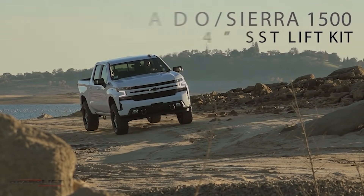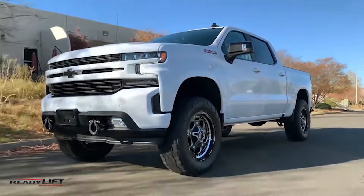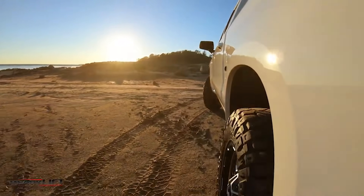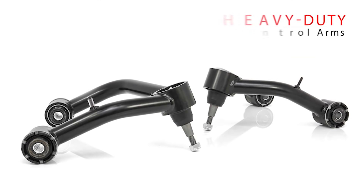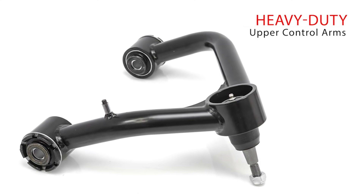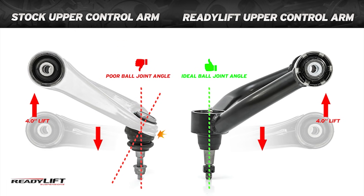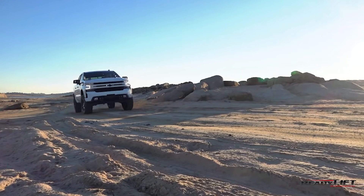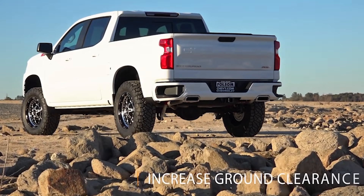Next up on our list, we have the Ready Lift four-inch SST lift kit. Although Ready Lift has started to get into the bigger kits, they've been doing their SST kit lineup for quite some time. With the success of the kit for the 14 to 18 GM 1500 trucks, they decided to continue the trend and bring it back for the 2019 trucks. Coming in at only $900, you get a really nice quality kit that includes a CNC billet aluminum spacer and new tubular steel upper control arms with adjusted ball joints. One of the best features is that it is a no-cut, no-weld, strictly bolt-on kit, making it easy to install yourself. With four inches of lift in the front and a three-inch block in the rear, it gives you a nice level but lifted stance to fit up to 20x9s and 295/65s or 20x10s and 33s with minor trimming.